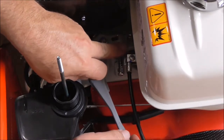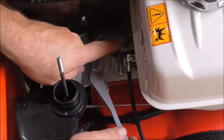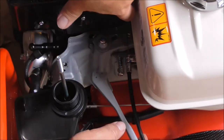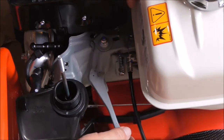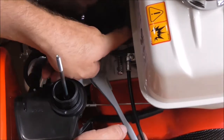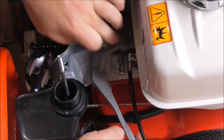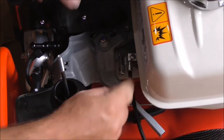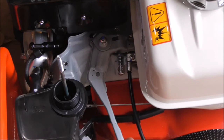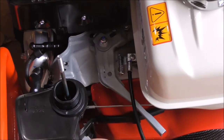If needed — depending on if your cable got stretched out or something — it may be necessary to loosen this screw down here and take up the slack in the cable. Grab the end of the cable; it's back in here between the muffler cover and the fuel tank. Use a pair of long needle-nose pliers to take up the slack, then re-tighten into position. You can also loosen this bracket and move your cable back slightly for fine adjustments. Basically, that's how the throttle linkage works. I hope that helps.